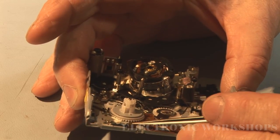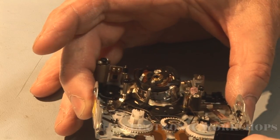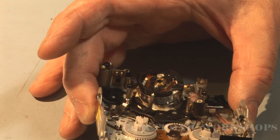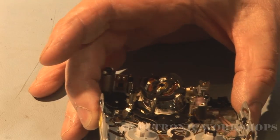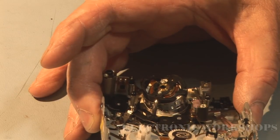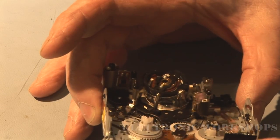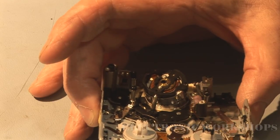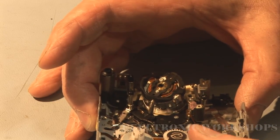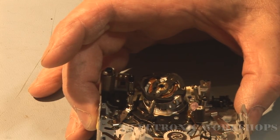Some of the print has gone in that cable. What happens is when it's in the open position they're not making contact, so it gives you that error - it thinks your deck has the anti-record tab set on it, so it won't allow you to record. But when it's in the fully loaded position it makes contact, so then you can do a recording. Unfortunately this part comes with the deck, so the whole deck has got to be replaced, and I'm not aware of this part being available as a spare - even if it was, it would take a lot of labor to strip this down to replace it.